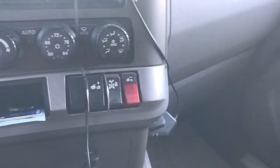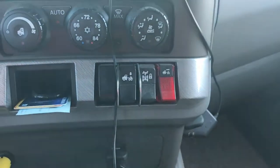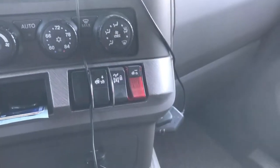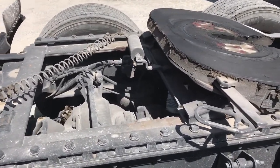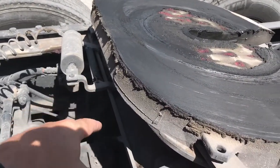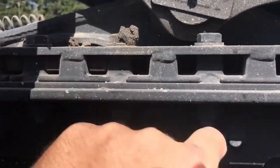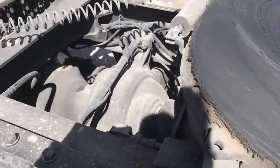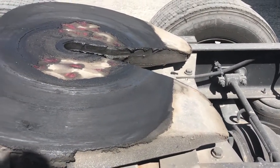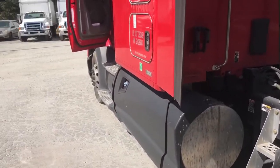Here's how you do that. There's this handy little switch — flip it up, and what that does is release the locking pins on your fifth wheel. Let me get out of the truck and show you what that looks like. When you flip that switch it activates this ram right here, which pulls out the two or three pins, and that allows the fifth wheel to slide forward and back in this track to adjust your weight between your drive wheels and your steer tires.